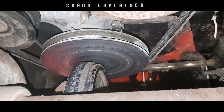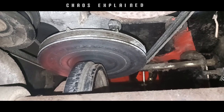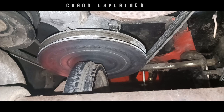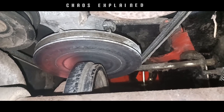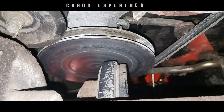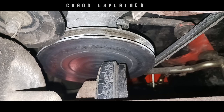Now I've got two issues. My friction wheel is worn out, so I'm going to replace it — you can find the part numbers on the side of the chassis of the mower, this one's like 927-something. I'm back to neutral and going to reverse. My first issue is a worn-out friction wheel, and my second issue is it's not even touching — worn out and not touching.